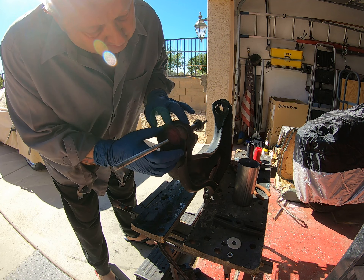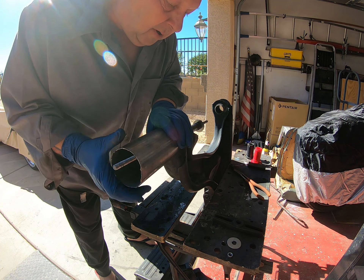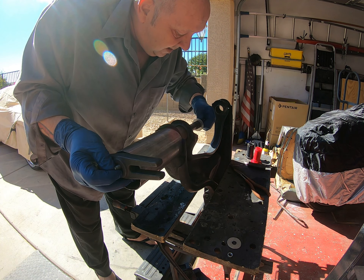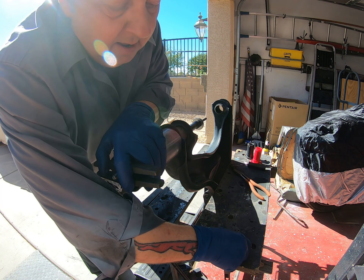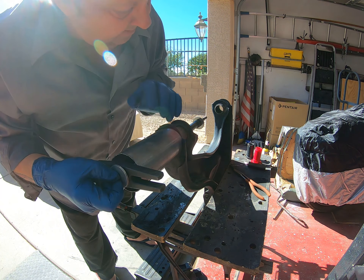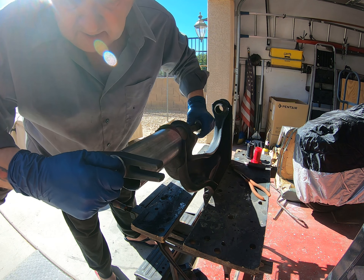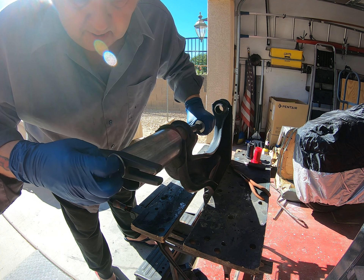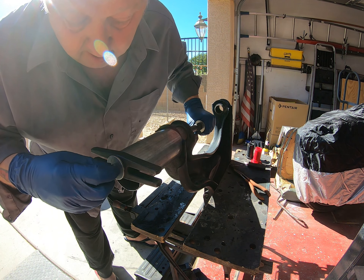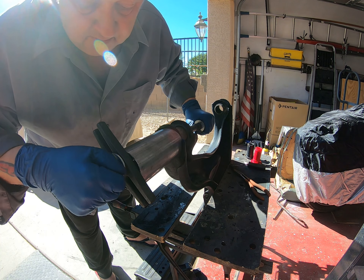What I've got is this piece of exhaust pipe and it fits over there perfectly. Then you just make it up as you go along. Just unscrew that a bit to give a bit more length. Got a big-ass washer over there - kind of need six hands to do this. Get the nut on there - and of course the nut decided to bind. So let's try putting the nut on the other way around. Don't ask me why, but that often works.